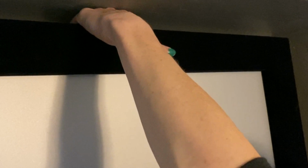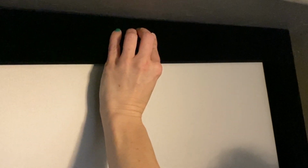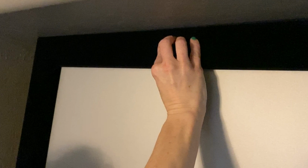It is recommended for 2 people to mount the screen onto the wall. In one of the top corners, carefully feel behind the screen to locate the screw and slide the mounting bracket to align with the screw. Mount the bracket onto the screw. Then feel behind the screen on the other side of the top to find the screw behind the screen. Slide the other top mounting bracket to align it with the screw and mount the bracket onto the screw.